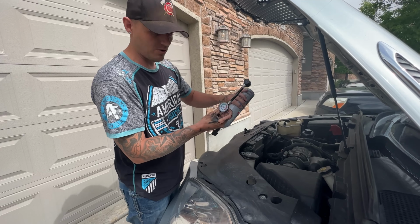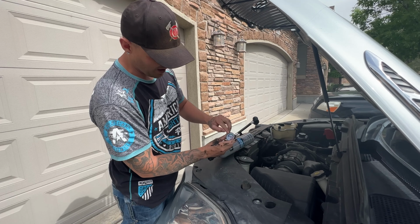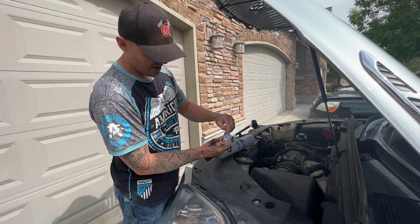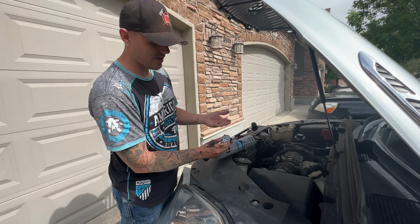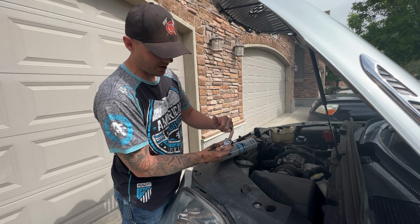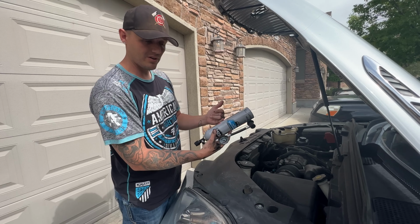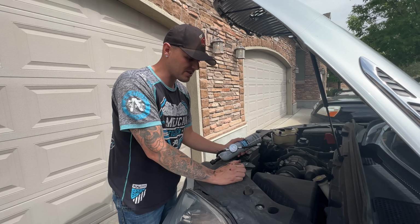And I used the whole bottle, by the way. It's completely empty. I ended up getting it up to about, I'd say 35 PSI. So we're still in the good range. And with that, now the AC stayed on and it wasn't kicking on and off. So I probably could use another bottle. So, I mean, with that, it does tell me that there is a leak somewhere.